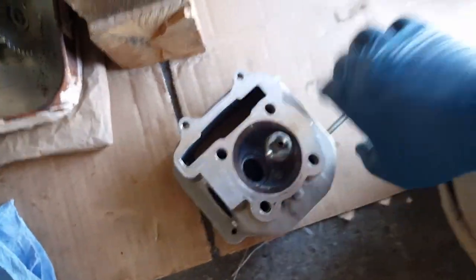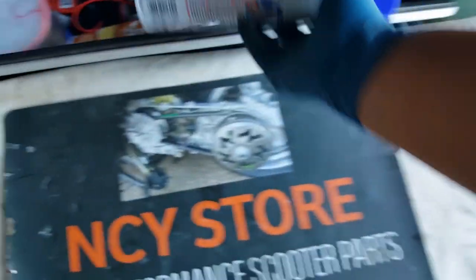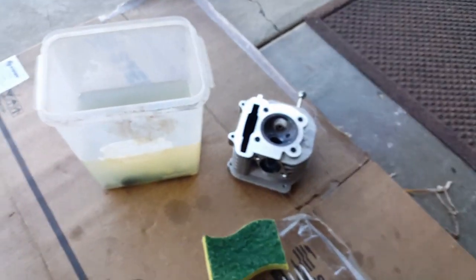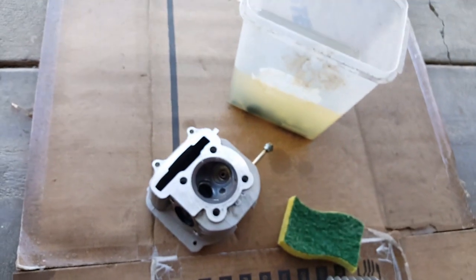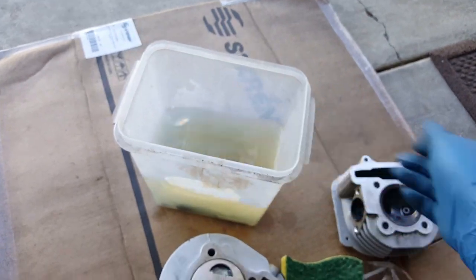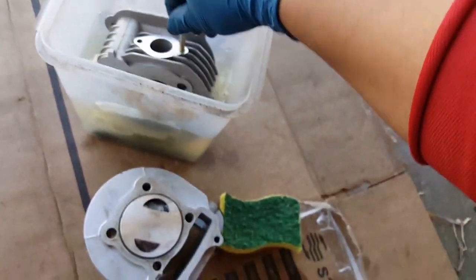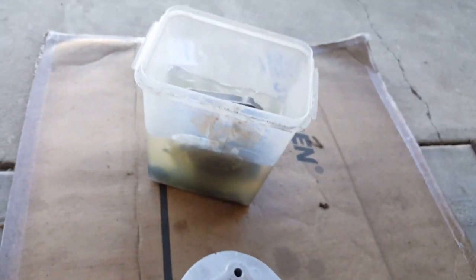You can actually use oven cleaner — I realized this engine degreaser from the auto parts store didn't really do much for me. Oven cleaner, heavy duty like Easy Off, you can spray it on there, leave it for a while, and use a scotch-brite to wipe off the carbon buildup. This is pretty much expected — carbon will build up, it's not going to stay shiny as when you first install it. It's actually just normal carbon buildup. We're going to go ahead and submerge this. The rubber seals are made to be tolerant to petroleum and gasoline, so it should be fine.